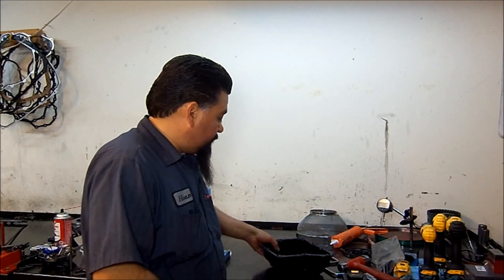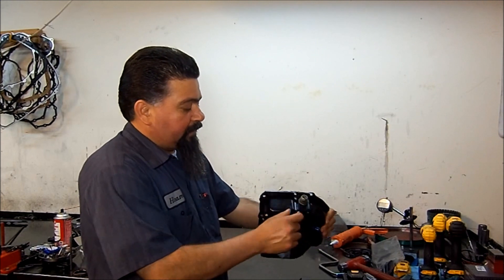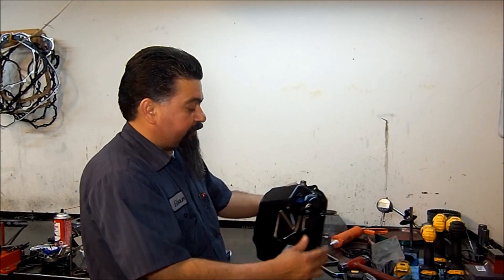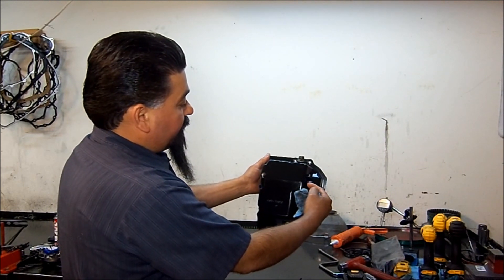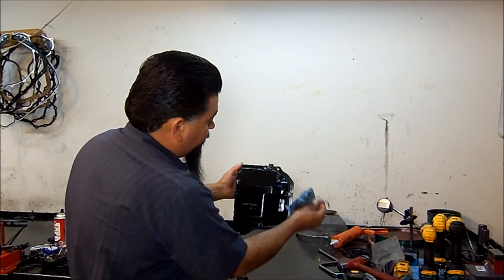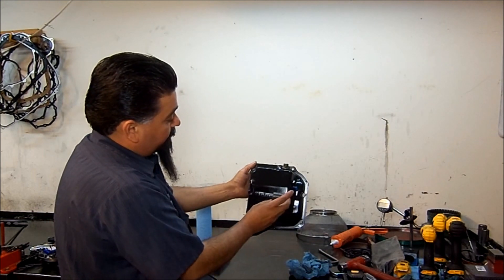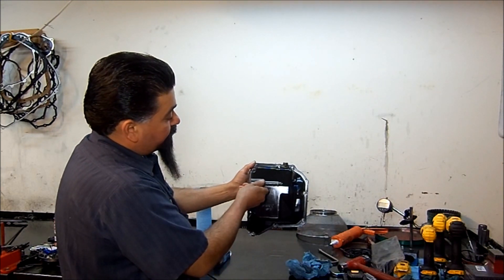I'm going to use a pressure transducer. I have this extra pan — this is off of a Volvo — it has the return cooler line on top but I have holes drilled here to adjust my solenoids. The SLT solenoid sits here, and then we have our shift pressure control solenoid, the green one, which is the APC pressure control solenoid.